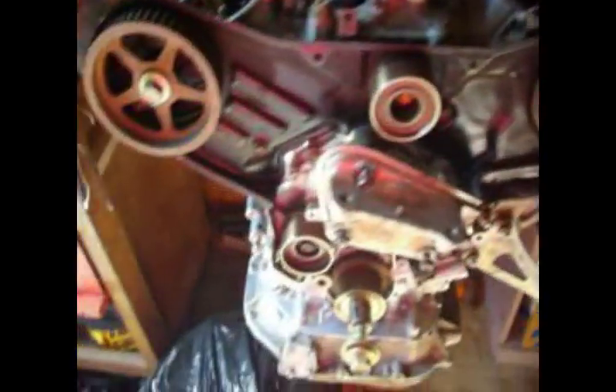So we go over to my 1MZ. The two dots are aligned on the right bank and one dot is aligned on the left bank. So then the cam sprockets.